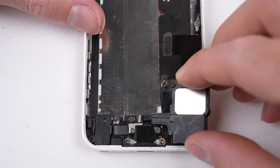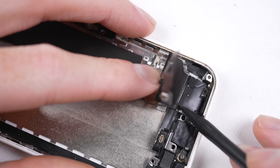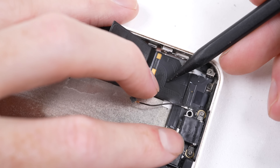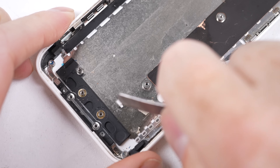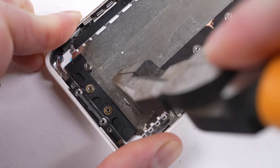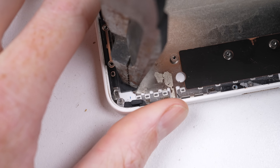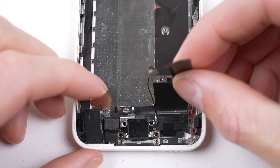But I spoke too soon, because I'd later discover screwing an SE charge port into a 5C breaks Touch ID functionality. Which is kind of ironic, but it's a result of this metal stake protruding from the housing. It's enough to pierce the charge port in such a way to stop the fingerprint function, but not the home button itself. This stake was really sturdy, maybe being the strongest piece in this whole phone - given its size, it was hard to get a tool onto it to bend it flat. But I eventually got it, and could install an undamaged charge port.